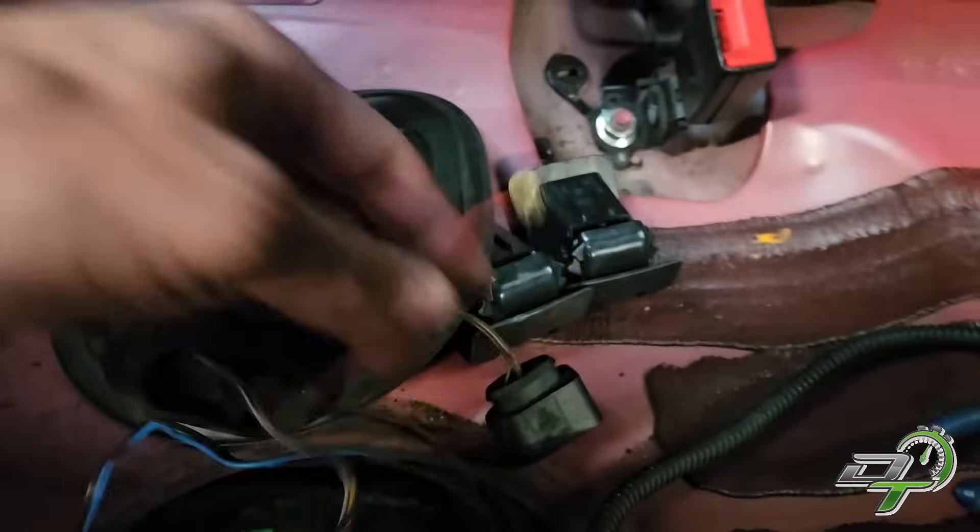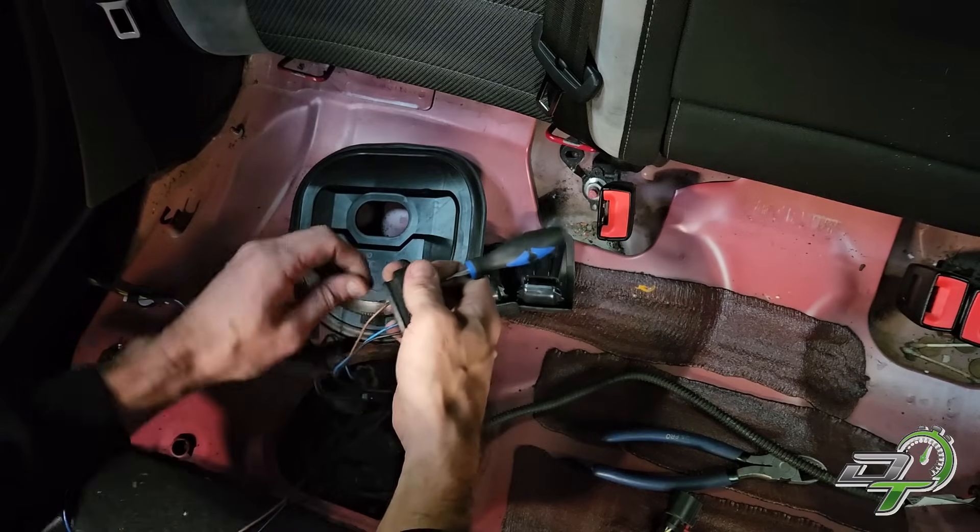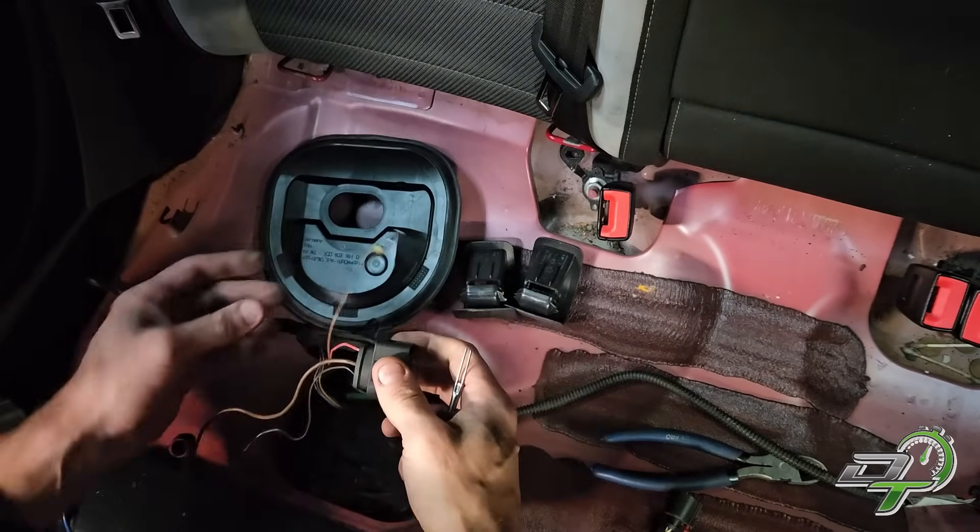The last little thing is the fuel pump. I mounted the RS3 fuel pump complete with its fuel into the car, which meant it was going to be RS3 spec. The fuel pump power actually comes off the same fuse — I think it's SP10. The Golf R has a one-millimetre cable whereas the RS3 has 2.5 millimetre, or possibly 2 millimetre. I'm going to run the one-mil and see what it's like — I'd imagine it'll be fine. I'll probably put an extra ground in there, but for now I've just de-pinned the Golf R connector and re-pinned the RS3's.